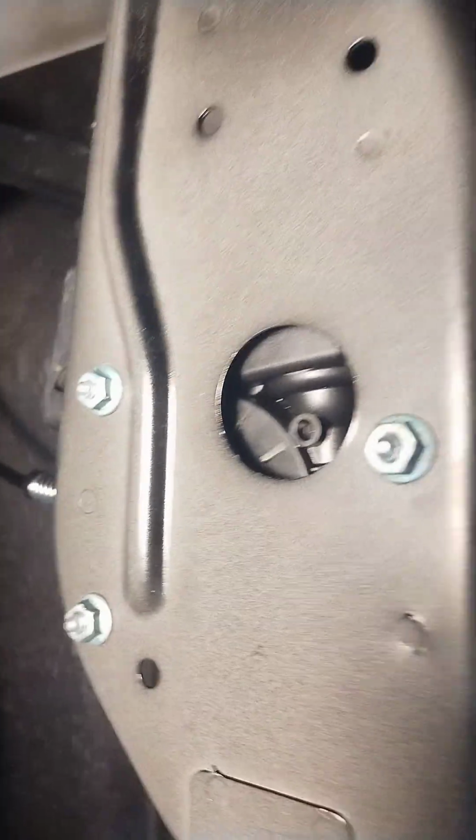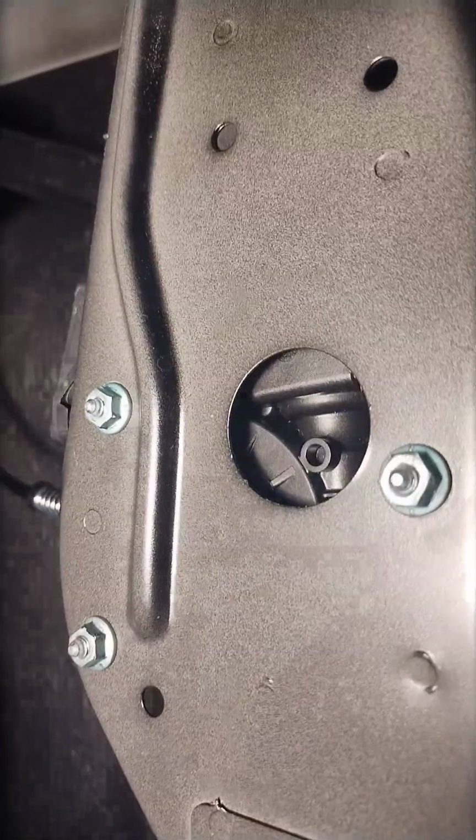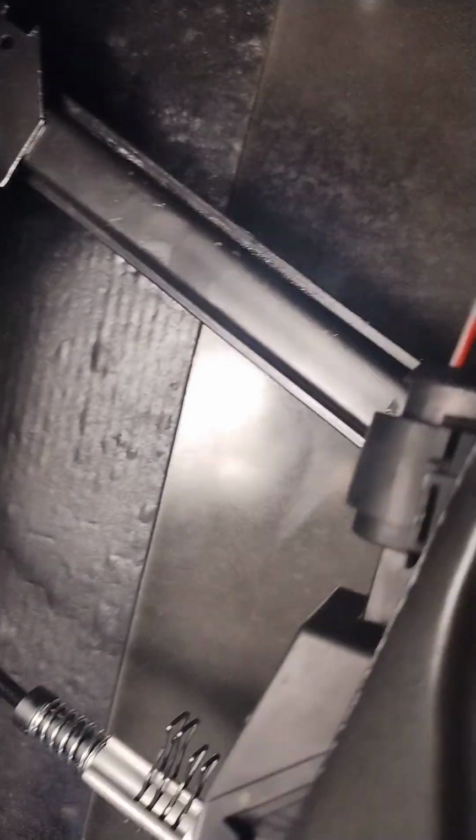Now, you're going to have to make sure you mark those on the bottom, providing that the guy that installed the last one lined it up right. I'm going to get to that in a point. There's the bolts or nuts for the motors, sorry. And to get that thing unplugged, you're going to have to loosen up that motor, and you just push a pick right in the center there. Can I get the light on it? Right there where that first flap is, you just push down there on the pick, give it a wiggle and a pull, like when you were a kid, and it'll come off. When you put that thing back on, make sure you press it on there until you hear it click.